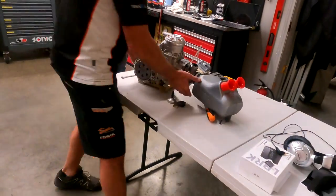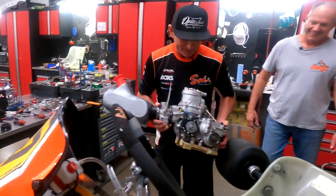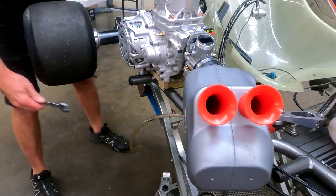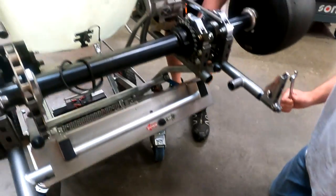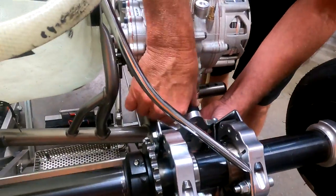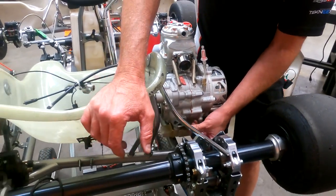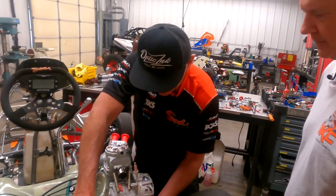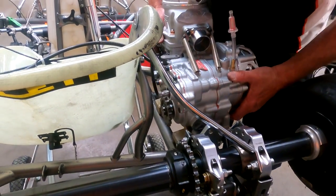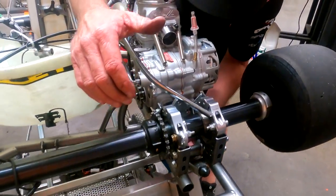It comes with a magnesium motor mount too — everything is in the box. The chassis is designed around the engine and that's exactly what we're doing, getting back to more modern times. All I'm doing is moving these jam nuts back so we can move the engine as far back as we can. Moving the engine all the way back gives us better clearance with the shift rod, gets it out of your elbow so it's not so far up front. My elbow will thank you.